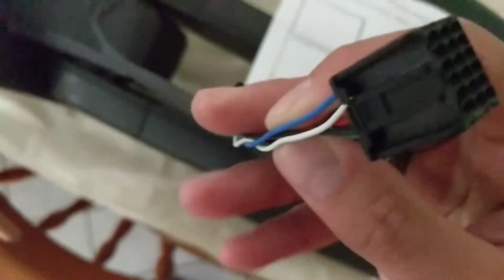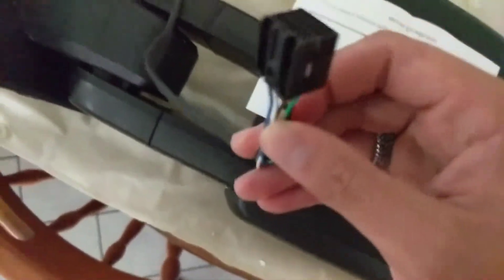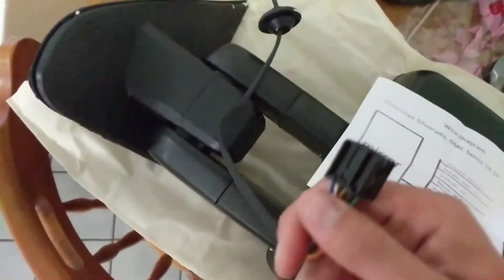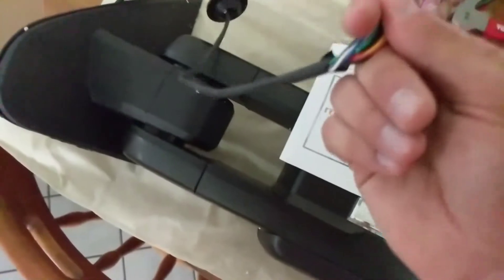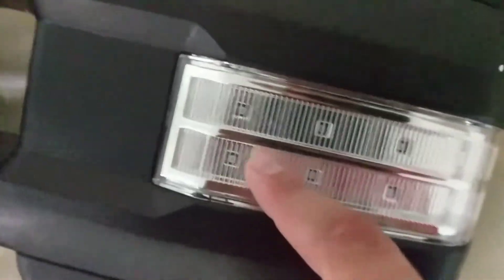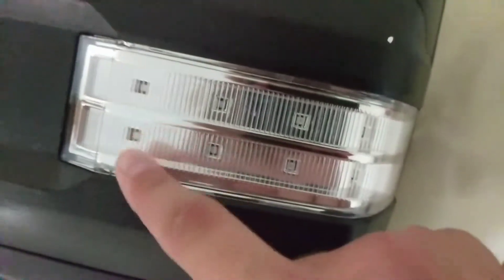The blue, white, and black wires — all that stuff — it all plugs right in, so all your lights are supposed to work as they should. As long as you have mirrors currently with turn signals, heat, and all that. When I do a switchback build, what I do is disassemble the whole entire mirror — take the light out, take the lens off. In this case, I have to paint the chrome backing on this one black and then add the light strips over that.